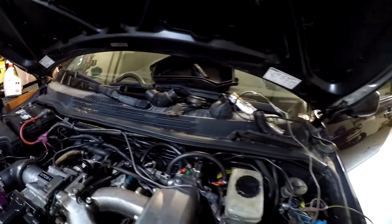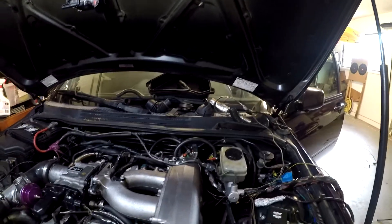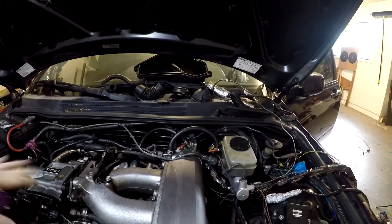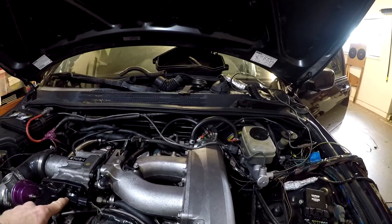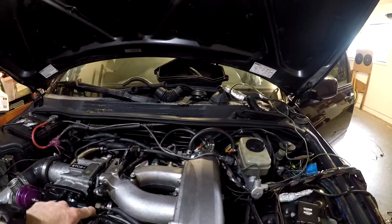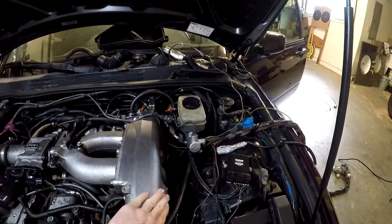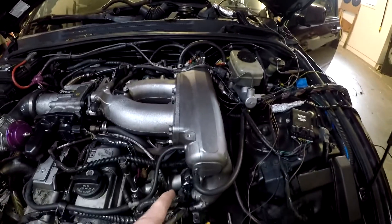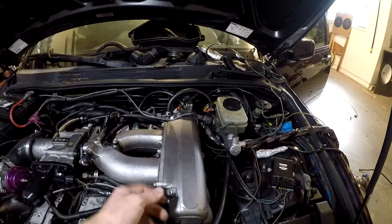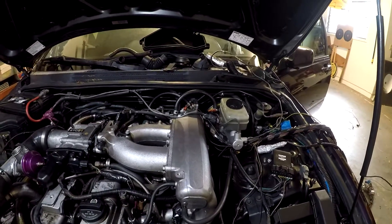The cam position sensor was back here — that's extended and goes back this way. As far as bundled wires: there are wires that are blue with a yellow stripe bundled up here under the intake manifold. That's accessory power for a lot of systems — like the TPS, possibly the motor. There are also brown wires bundled together, black with red stripe bundled together, and I think blue with a red stripe bundled as well. You can access those wires by removing the upper intake manifold.